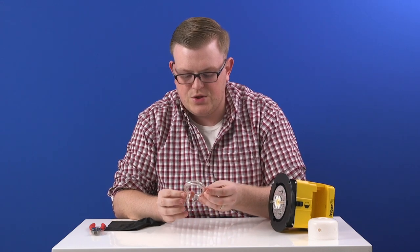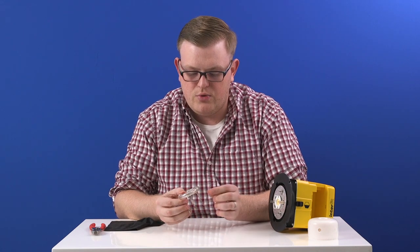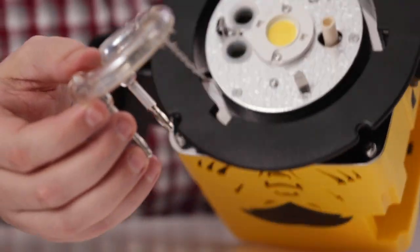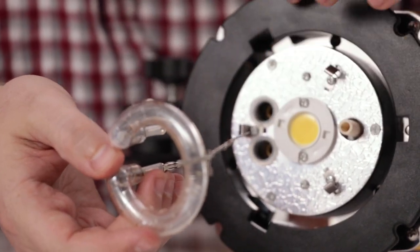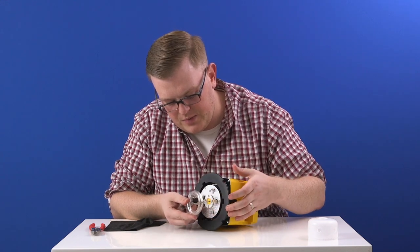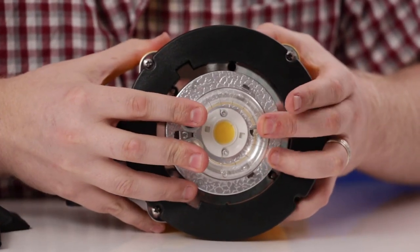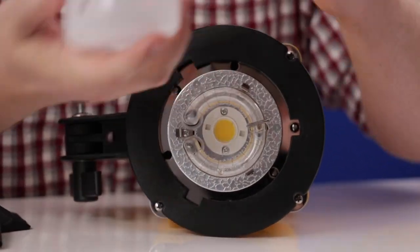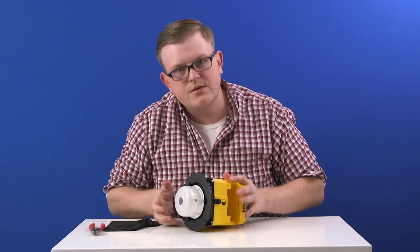Reattach the spring to this clip. Now that everything is reassembled, it should look like this — you have the two prongs, you can straighten that out, two prongs and the third stabilizer prong. Take your light and essentially just line the three up and push them in. There are two metal sockets where the two terminals insert when you get it into the light, so you want to make sure that all three line up. Once they're all lined up, just push it into place. Then your last step is to reattach the glass dome, and that's all there is to it.